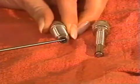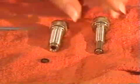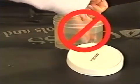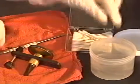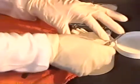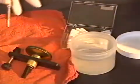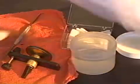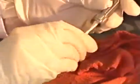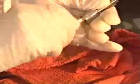Remove the rubber O-rings with a hook scribe in your kit. Wipe the O-rings with a clean, dry, lint-free cloth. Do not allow the O-rings or skin to come in contact with the acetone. Soak the injector base and the injector press in acetone for at least 10 minutes or overnight. Remove the injector from the acetone jar. Dry the outside with a clean, dry, lint-free cloth. Use 2 or 3 new dry cotton swabs in a twisting motion to dry the inside of the injector base.